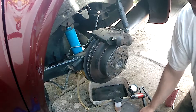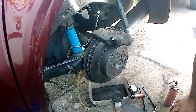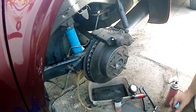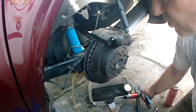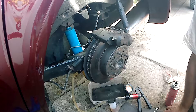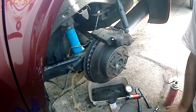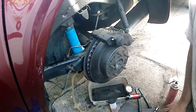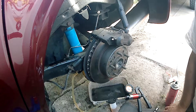Now that I've got speed bleeders on, it'll be super easy to bleed these brakes. Alright, my YouTube viewers, thank you for watching. Moral of the story: flush your brake system. Other moral of the story: if you have a vacuum pump like this and you're not getting fluid out from one of the corners of your car, you might suspect the brake hose — even if you replaced it, even if you restored the car from top to bottom, things go bad. You need to redo what you've done already, even though in your mind it's still brand new. Thanks for watching, I hope you found this useful.